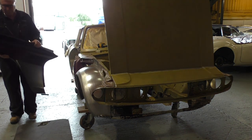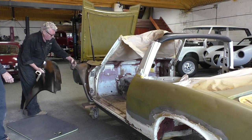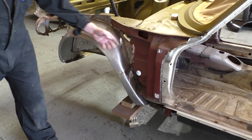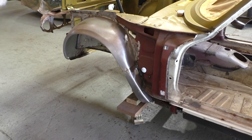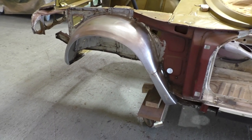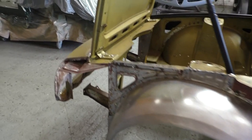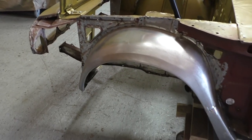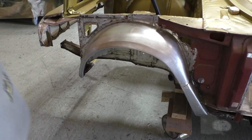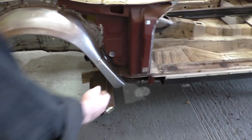Massive difference, isn't it? We get all of this properly — and it's not even finished, it's just red oxide work. That was the only protection on it. And around the front there's nothing — that's why it's like it is. They're nice panels inside though — made really beautiful. They just didn't fit; they have to be at the right distance for the wing to nip over. It was too short here so I had to extend it, and it was the wrong angle down there so I had to cut and shut down there.